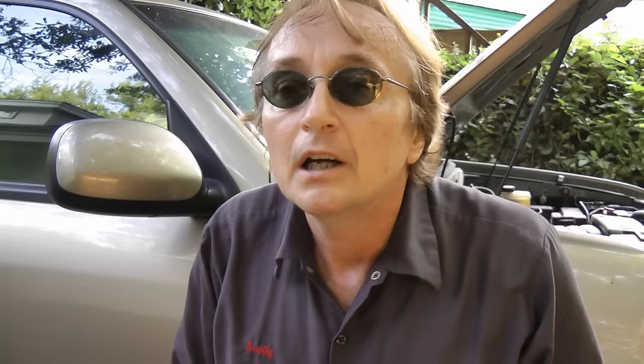This came with a factory Nippon Denso. Always replace it with the same brand. Because regardless of what some companies may say, if you don't use the original equipment brand, a lot of times the aftermarket ones won't mesh with the software and the light will stay on. You'll have problems. So even though you might be tempted by a brand that costs less, don't take the chance — use the original equipment company.